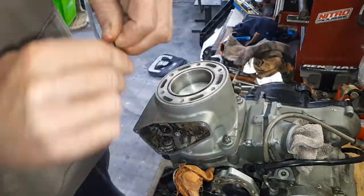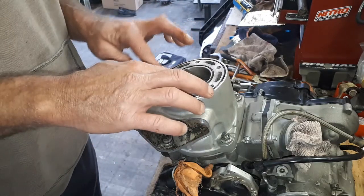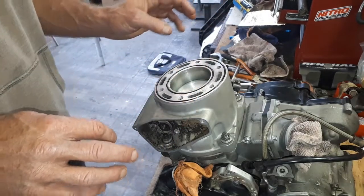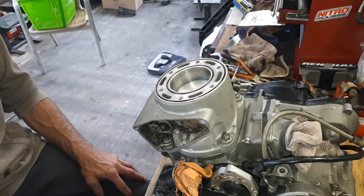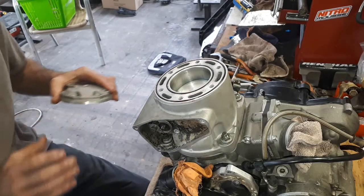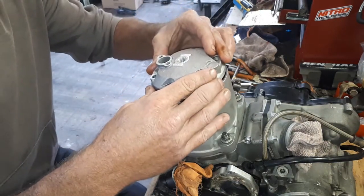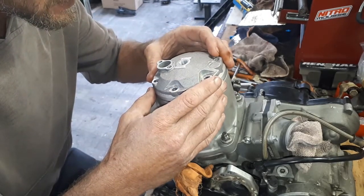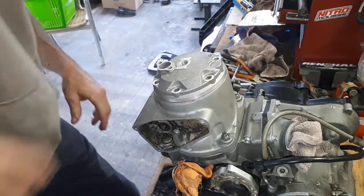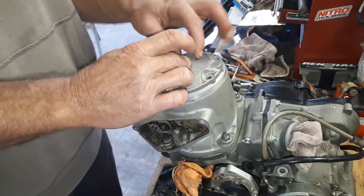Okay, there we go. I've got both the O-rings sitting in there. This one is going to try and jump out now. They're going to sit there for a second. A little bit of grease in there really does help. Then I'm just going to line up my head. I don't really want to twist this or anything, just sit it straight in there. Hopefully those O-rings won't bloody move. So looking nice and flush the whole way around. I'm pretty confident those O-rings are still sitting in their grooves. They should be pretty right there, I think.